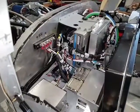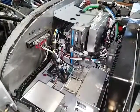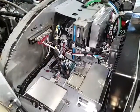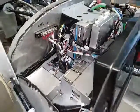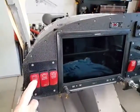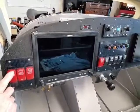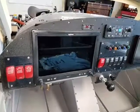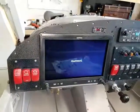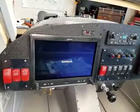The avionics has been rewired and rerun, the cable groups and all the connectors have been rerouted and secured. Let's turn it on and see what happens. We'll start with power — that's the main breaker over here on the firewall or instrument panel. That's what actually brings 12 volts to the aircraft from the battery. You can hear the solenoid snap, and then the Garmin comes on and it'll come up in a minute.